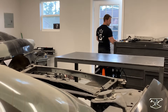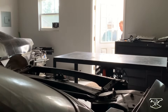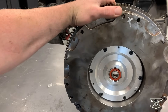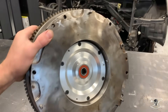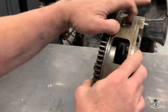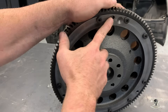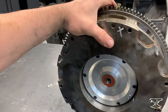Now for another trip back to the machine shop. I got a quick turnaround at the engine machine shop. You can see they rotated this thing — they've marked it here and on the bottom where the opposite side was. This is the side they had to remove material from. On the original spot that lined up, right in that corner there, they took an additional three ounces out of it. So now we have a perfectly balanced flywheel. We can get back to building the adapter plate.